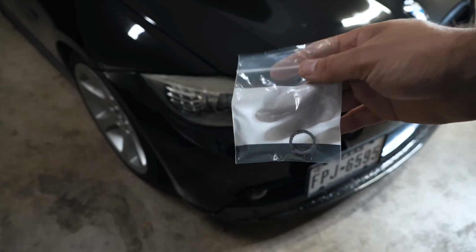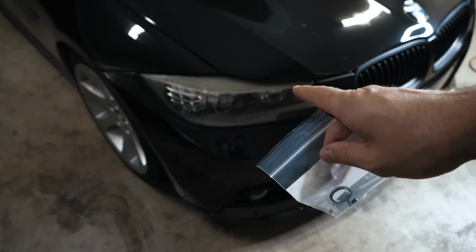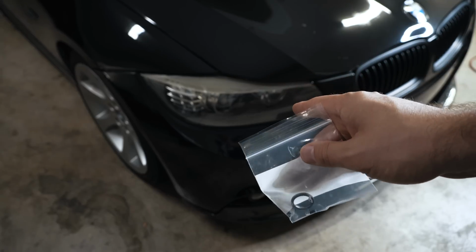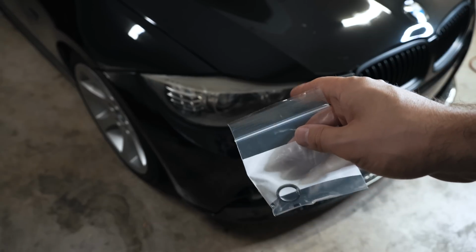So I've been tackling a cylinder 6 misfire on this car at high RPMs, above 6,500 RPM. I've worked with my tuner and whatnot to see if we can get that eliminated. I've done coils, plugs, the usual stuff that you would tackle when you're encountering an issue. Data logged, and I keep getting the cylinder 6 misfire.